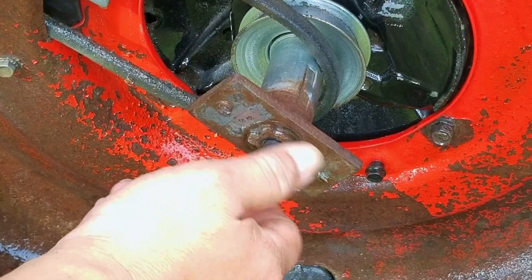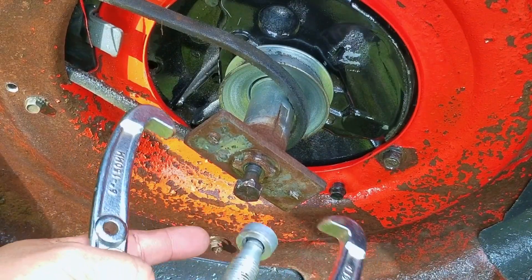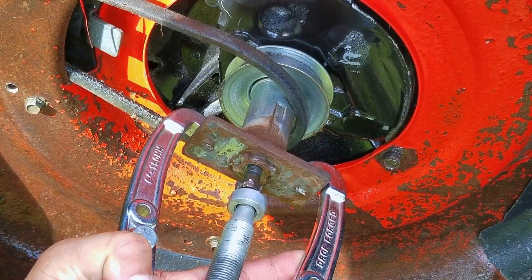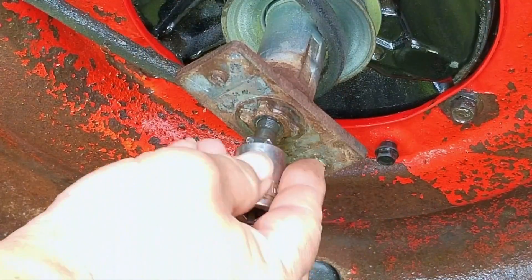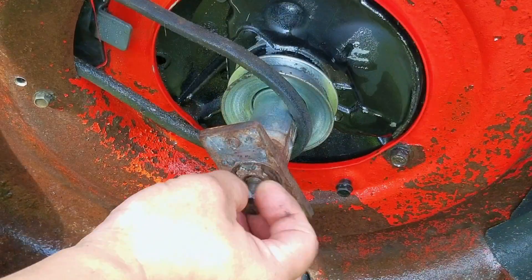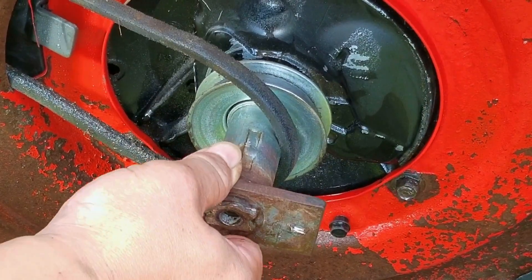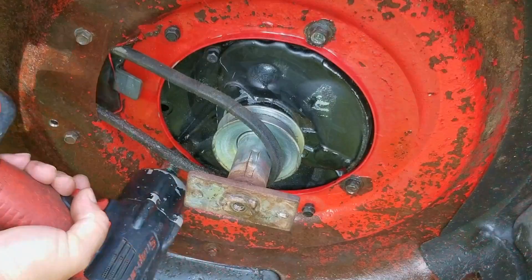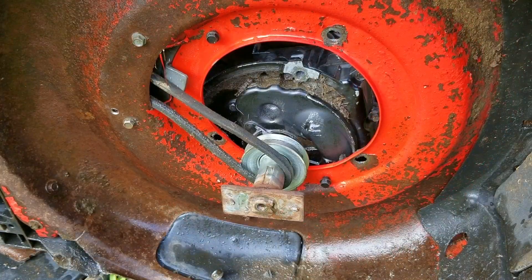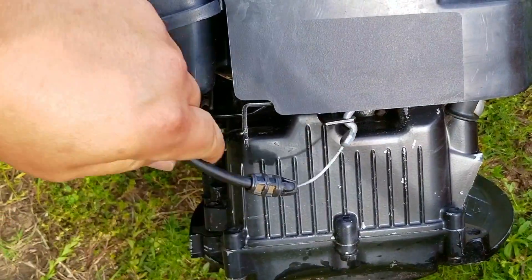Typically on this type of adapter, when the blade hits something hard and the engine stops, the key stamped into the blade adapter will be pushed back out. It's tough to tell while the adapter is still on the shaft, but the big giveaway is that the adapter will be very difficult to remove. On this one I had to keep working the crank bolt back out until I finally decided to take it off while the engine was on the table. The designers realized that one of the problems a mower can have is the blade hitting something it shouldn't. So to keep from damaging the crankshaft — which costs a lot to replace — they designed the adapter to take the damage instead, since it's a lot easier and cheaper to replace.